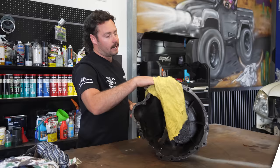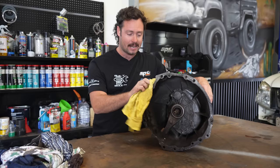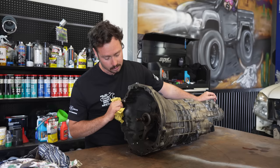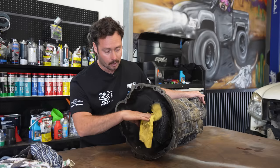Alrighty, so what we've got here, a couple of episodes ago, we rebuilt the RB25. It made like another 150 horsepower, and as I suspected, second run out blew the gearbox. Third gear absolutely smashed itself. Now these are getting rare. An RB25 box, you pay almost $2,500-$3,000 for a second-hand one. So what I've decided to do is rebuild the one I've got, because then you ensure that it's brand new rather than buying one that's probably got 100,000 Ks on it anyway.